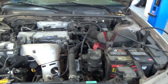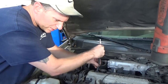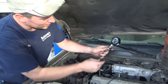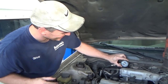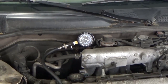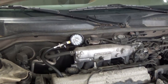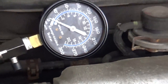I do smell fuel — before when it first came in, it smelled of fuel. I'm going to need you to crank this over, Tammy. Basic compression test. Nada — she doesn't have anything. There's really not much left to do, guys, other than to start tearing into it. Just off of sound alone, it's pretty obvious to me that this thing either has some major mechanical problem in the top end — which is kind of unlikely — or has a jumped timing belt.